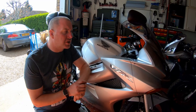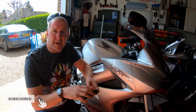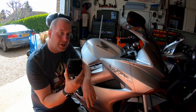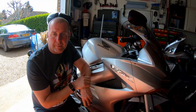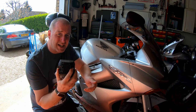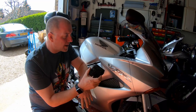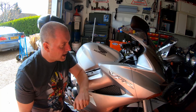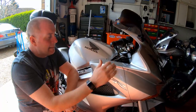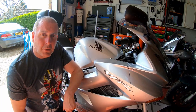Hello everyone, welcome back to the channel. This is part two of the regulator rectifier replacement. As I said in the previous episode, what we're going to do in this one is create a mounting plate in order to make the Shindengen regulator fit the frame of the VFR. Obviously the shape of the stock reg/rec is not the same as the Shindengen one, so we need to make a small adapter plate so that it will bolt up fine and be held securely on the frame. First I need to get at the reg/rec which is on this side of the bike, so I'm going to get this panel out of the way.